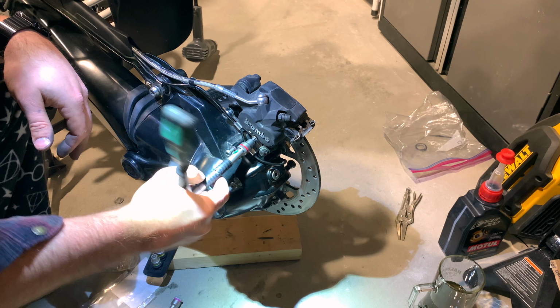And then finally, after this video, I'll be doing a few different modifications that involve the final drive, because this is about $2,000 to $5,000 in parts if you damage it, and so I want to protect it. So that's a whole long video. We're going to get into it now by starting off with draining the final drive. You can't lube your splines without the final drive free of fluid. Okay, let's get started.